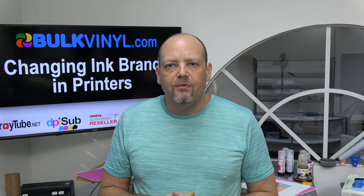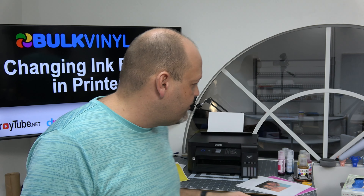This method seemed to work really well. Mixing the ink went okay — the only result was better print color quality and clarity. Draining it completely was more tedious and more work, but it did work. If you're going to drain it just to switch sublimation ink, I would probably just draw as much out as you can, put the new ink in, draw that through the lines to prime it, then do a few full-color pages, a nozzle check, print head alignment, and maybe a power cleaning as a last resort. Power cleaning uses a lot of ink, so if everything is printing okay and you can print five of those pages without problems, you're probably going to be okay going forward.